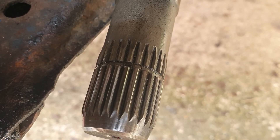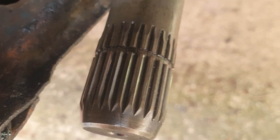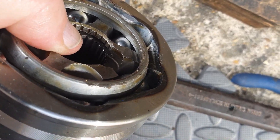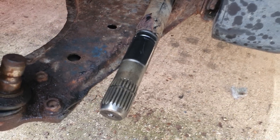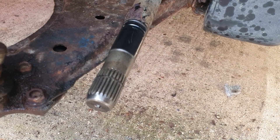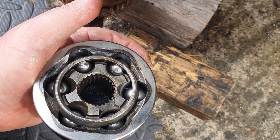We've got that off. I ended up using a different pair of circlip pliers because the tips were closer. There's the circlip — you don't need to take it out, just get in there and open it up. Clean the end of that shaft up — there's the groove that the circlip clips into. You basically just insert it in that groove, fill this full of grease, and don't forget to put the boot on first — otherwise you're going to have to go through the whole process of getting it off again. So: put the new boot on first, fill with grease, put the circlip in, fill it up with grease, and slide it back on.